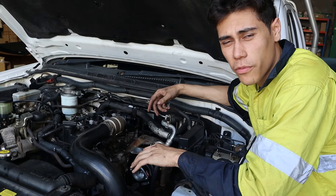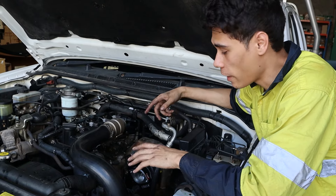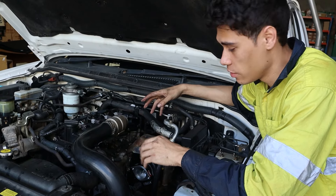When you've got a fresh turbo, before you start it up you want to get some oil into it - that way you don't destroy the bearings in it. Crank it dad.